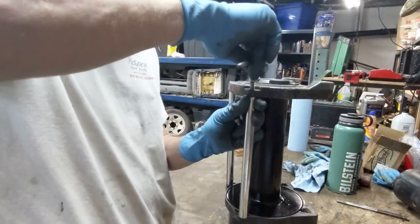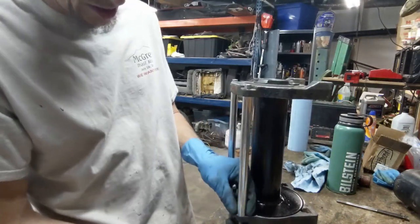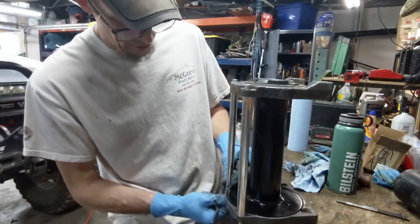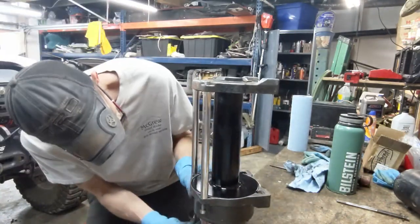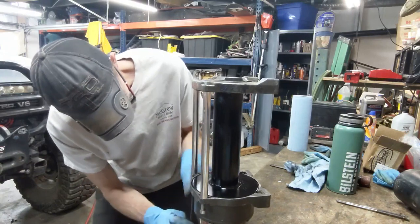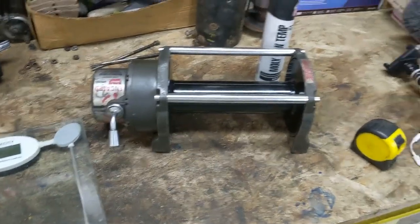The damage to these tie rods is caused by bundling your spool up on one side while you're winching in. You can see these are rubbed on and pushed - that was basically what was going on and why they were damaged. I'm a big fan of synthetic rope. Probably not as likely to have something like that happen when you do that. This winch is going to get rope.